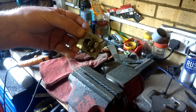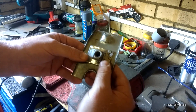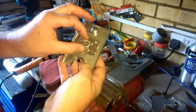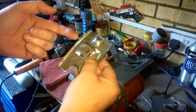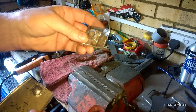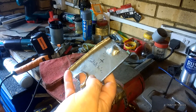I think that's the easiest way to do it once I've got the positioning correct. So imagine it's like that — let me put the light on, sorry, I haven't got any lights on. There we go. So yeah, that cross-hatch there — the nut will be there. This will have to be spot welded to the reinforcer and then obviously welded around. I'm going to weld it onto a section of metal first, then plug weld it to this, and then this will be plug welded to the inner wheel well. It's these little jobs that turn out to be quite time-consuming.